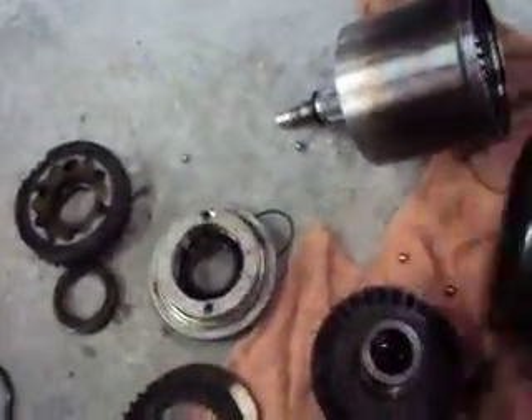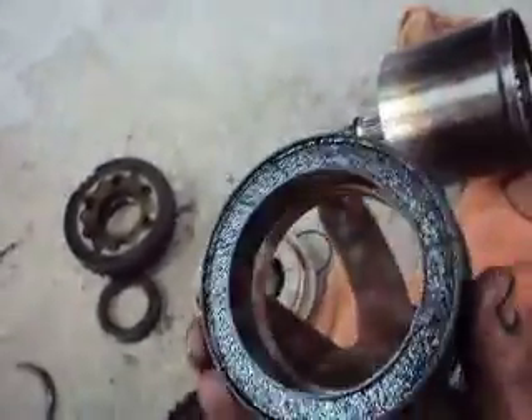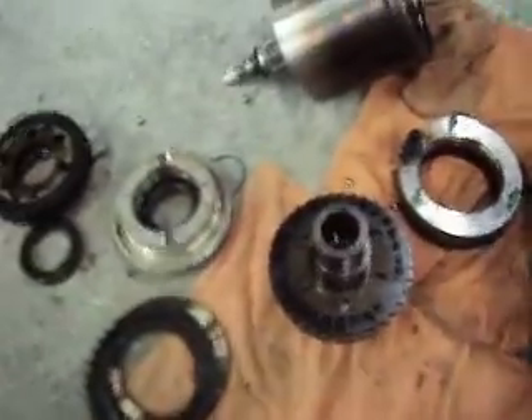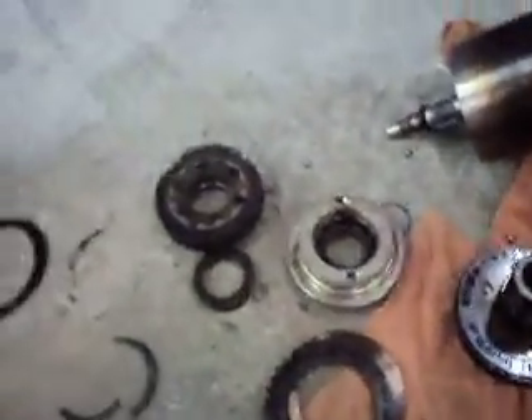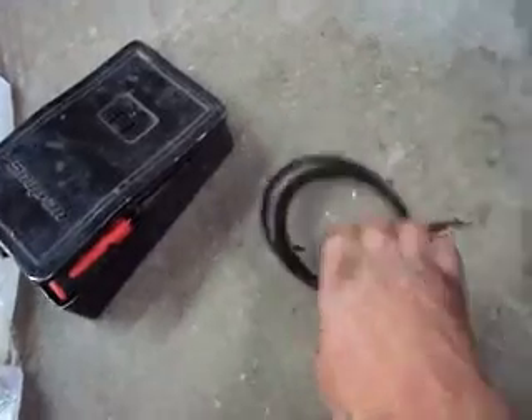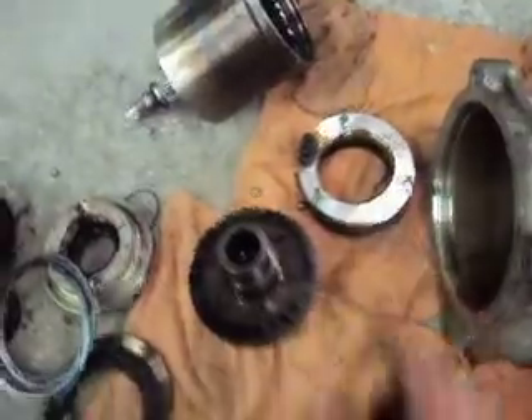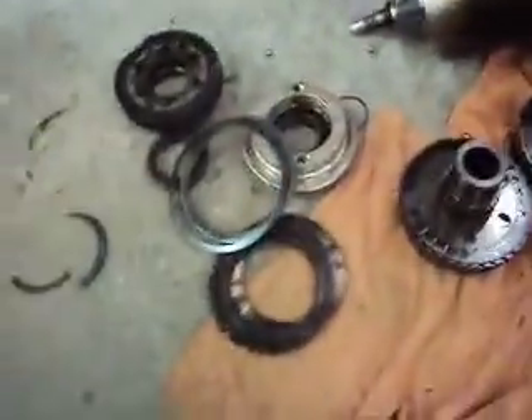This is actually very similar to what you find in most automatic transfer cases, with the clutch assembly and the cam assembly pushing up against the clutches to tighten it all up. We replaced all this and we're good to go. The vehicle runs again and turns nice and smooth — you don't hear any chattering or problems like that. There's typical transmission-type hardware here: a washer and a curled lock ring to hold everything in. Nothing here is really under any pressure, because it has to slip on its own until the magnetic clutch is activated; everything is supposed to slip with very little restriction.